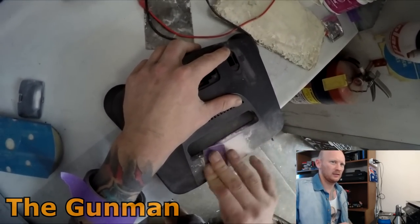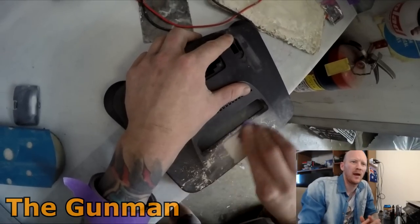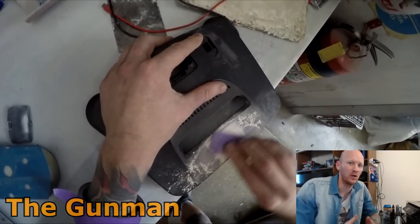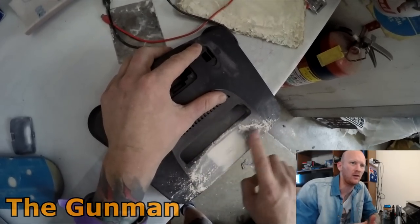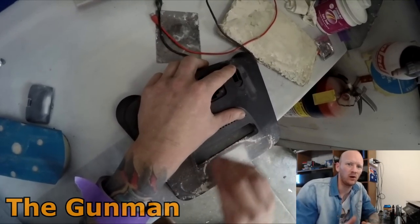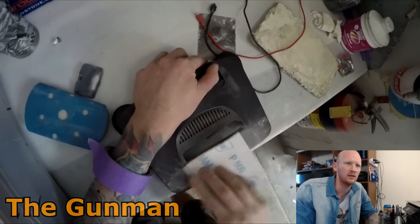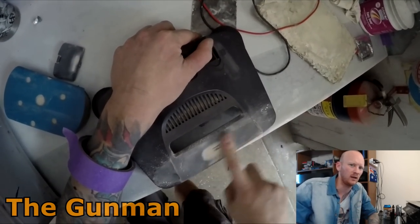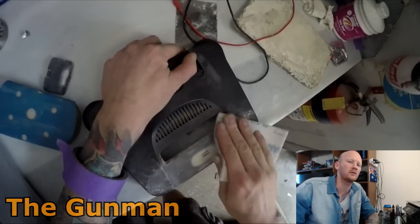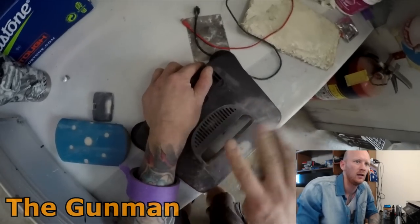So what I actually did is got the sandpaper around there and opened it up a little bit. No matter how good you are, you're still going to get a bit of a build up in paint, especially on a job like this where I did want to flow coat it. And yeah, later on in the video you will see me actually flow coating this, because where I'm putting all the logos and the stencils, there's going to be a slightly raised section from the base coat stage. So I'll put clear coat on it first, put a nice amount there so that I can sand that down, and then reapply some more clear so that the finished product is a completely flat surface without any raised sections.